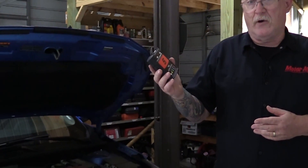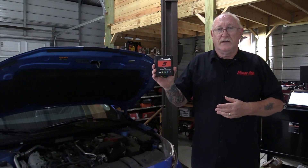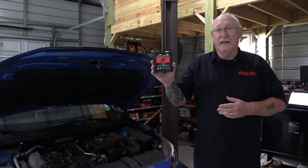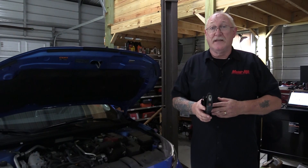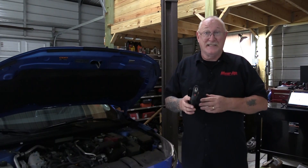Now some of you who use Snap-on may ask what's that in my hand. Well, this is part of the Zeus Plus — the newest addition to the Snap-on diagnostic tool line. One of the changes they made was making the scope module an individual component, which makes it a lot easier to use. The easiest test to gauge the overall mechanical condition of the engine is called a relative compression test. It uses a scope to monitor either starter current draw changes or voltage drop changes at the battery caused by each piston moving through TDC compression.